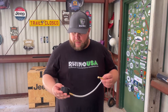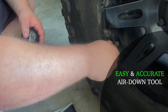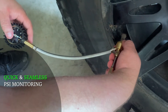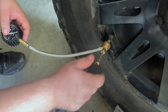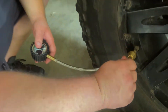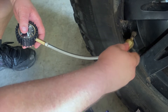I run one of these in my Jeep and out of these three, they just keep getting better. So we've got our cap off — you thread the entire body on just like you would your cap. Once it's all the way down, you'll feel it catch the core and you start backing the core out. Take the collar here, watch the gauge, and when you've got your desired PSI, thread the core back in and back the whole unit off. And you're good to go — just like that.